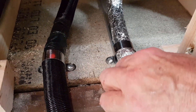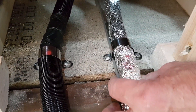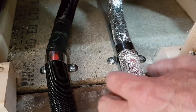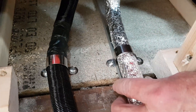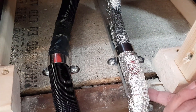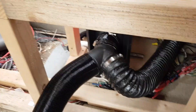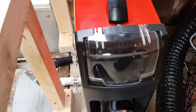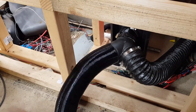This is the exhaust that was coming out. We've wrapped it in foil — twice as much as what the manufacturer actually said to do. We've also put a plate underneath it to stop any burning from the exhaust through to the timber itself. The heater is going to be on no longer than half an hour tops, but that will suffice and will not cause a fire hazard. That leads us to a point where, before we start screwing anything down permanently, we need to do a bit of a test run. So we'll fire it up and see what sort of heat this gives out.